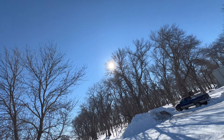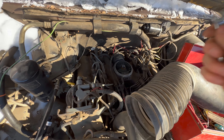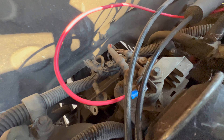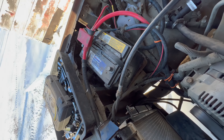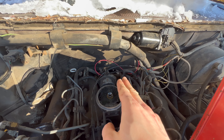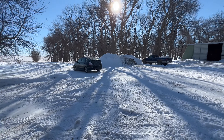It's a beautiful nice day today — it's in the 30s. Well actually it's been below zero, so anyway I'm gonna get back to work and see what I find out. I got a better wire on there, securely on there. I'll go inside and check the ground stuff. There's nothing more I can do with the glow plugs right now, it's getting chilly. I'm gonna put everything back together, clean the battery ends, not even test the batteries right now, and go from there. If it doesn't work, then the relay is bad.